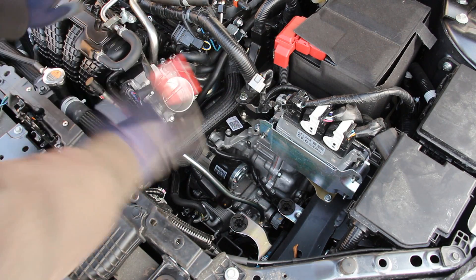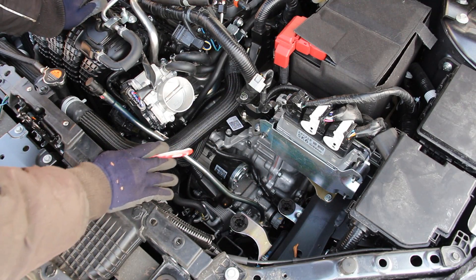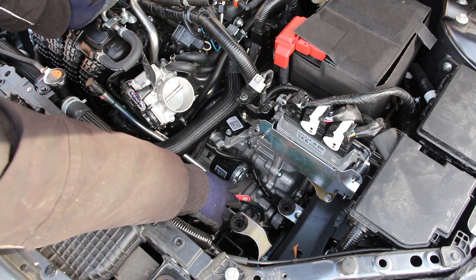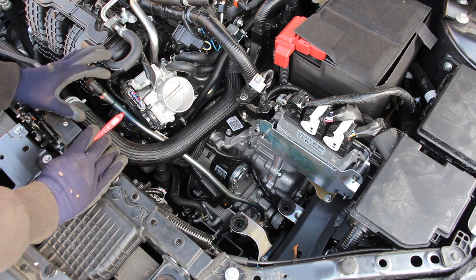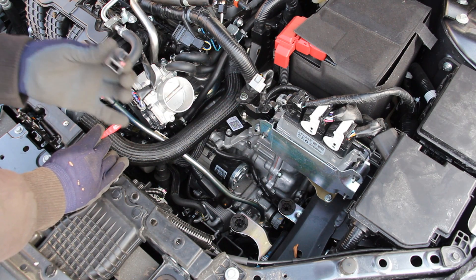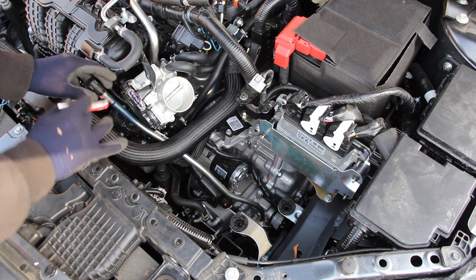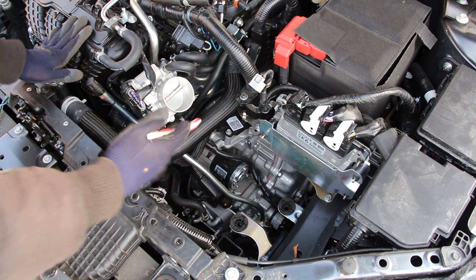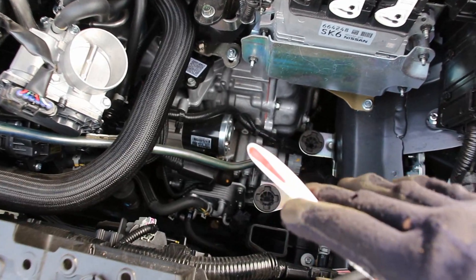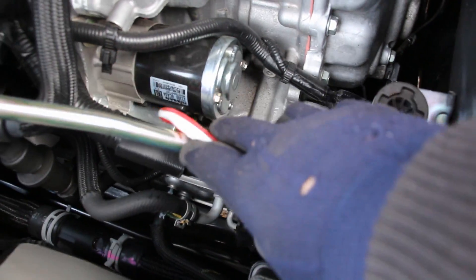With the air intake removed we have clear access to the top of the CVT transmission. Now contrary to what a lot of people believe, this CVT transmission isn't really a sealed system — in fact it has a fill tube that goes from the top of the transmission all the way up to where the throttle body is, where this dipstick would be. Except there isn't actually a dipstick attached; you'd probably have to order the real part from Nissan. The service manual doesn't really indicate much about checking the transmission fluid with a dipstick — in fact you have to do it from underneath. At the top of the transmission we have the starter motor which is pretty easy to access and change out, just two bolts and it should just pop right off.